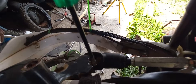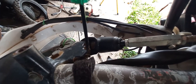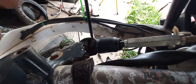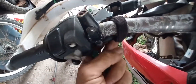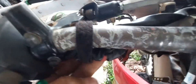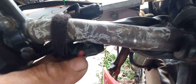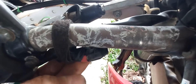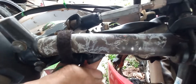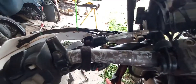Once you clean those, another good little tip: if you want full control of your bike and you don't want to be controlled like a baby, you can get this clutch starter switch here. There's a couple of wires on it — take the wires off and bridge them out. I've used a couple of speaker connectors with a loop of wire so that I can put it back to standard, but there's no need — you could just cut that off and join them together.